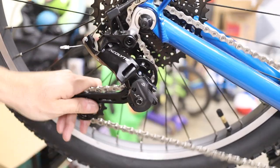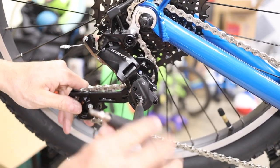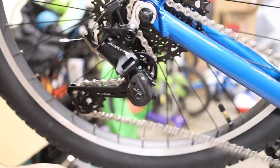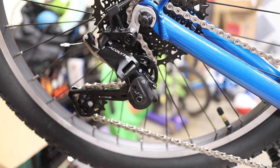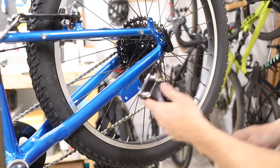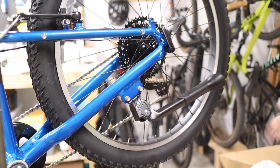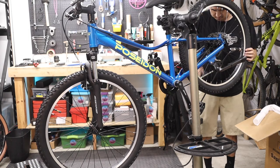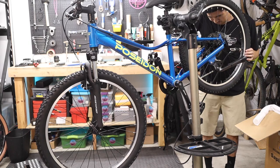Generally you'll have slightly better shifting performance with the clutch disengaged, but if the trails are going to get rough, it's better to engage the clutch to reduce the risk of the chain falling off or chipping the frame's paint. Next, install the included kickstand using the two 5mm allen bolts, and then inflate the tires to within the recommended pressure range printed on the tire sidewalls.